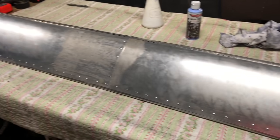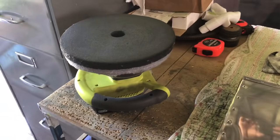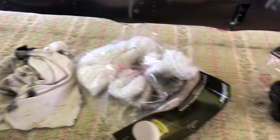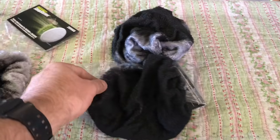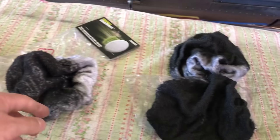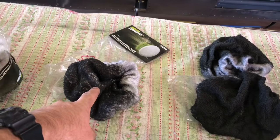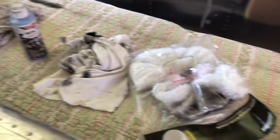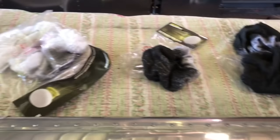It's just going to take a few extra going-overs. This is my setup for polishing — I've got my orbital sander, rags, the polishing liquid, and the various polishing pads. You usually start off with this one — these I just end up throwing out — and then you start off with this one, lots of rags in between, then go over a second time with more rags, and finish it off with the woolen one, more rags. For the real hard spots I've got a polishing attachment for the drill — that's handy as well from time to time.